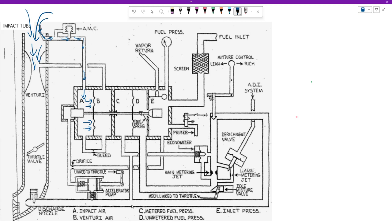This wall right here is a diaphragm, a rubber diaphragm. That diaphragm is attached to a shaft that goes back and forth, and it's also attached to this diaphragm right here. The shaft end is attached to a little poppet valve. So air pressure comes in through here, pressurizes chamber A, and pushes against this diaphragm, forcing the poppet valve to the right, which is an open position. The air then comes through here and across the throttle valve, which represents mostly a closed or idle position, and then off into the supercharger, manifold, and into the cylinders.